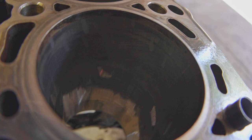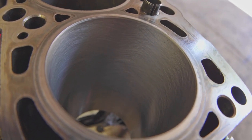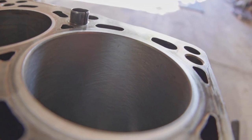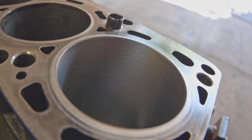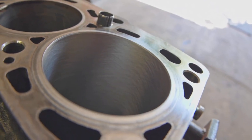So this is an old cylinder for comparison, and this is cylinder four after freshly honed. You can see my crosshatch angle after doing that wasn't quite there — I might take one more pass at it to make sure it's a little more 45 degrees, but it's definitely enough. I also might just leave it.